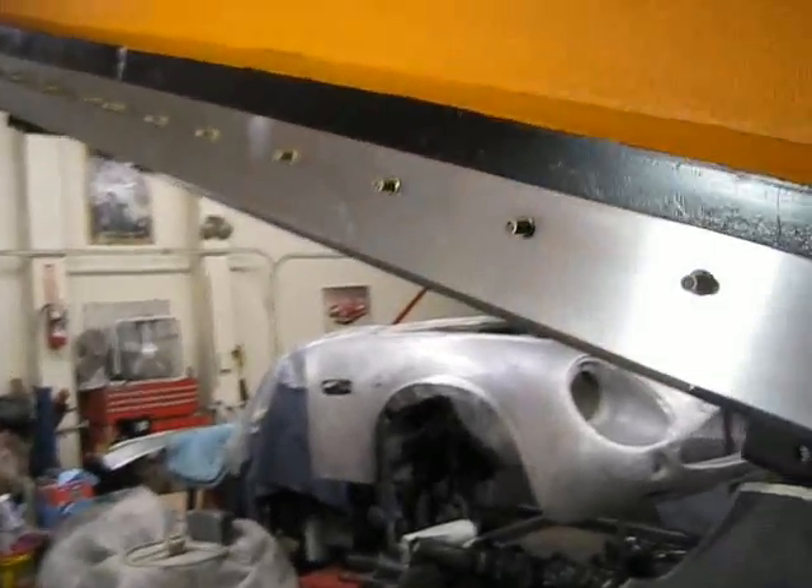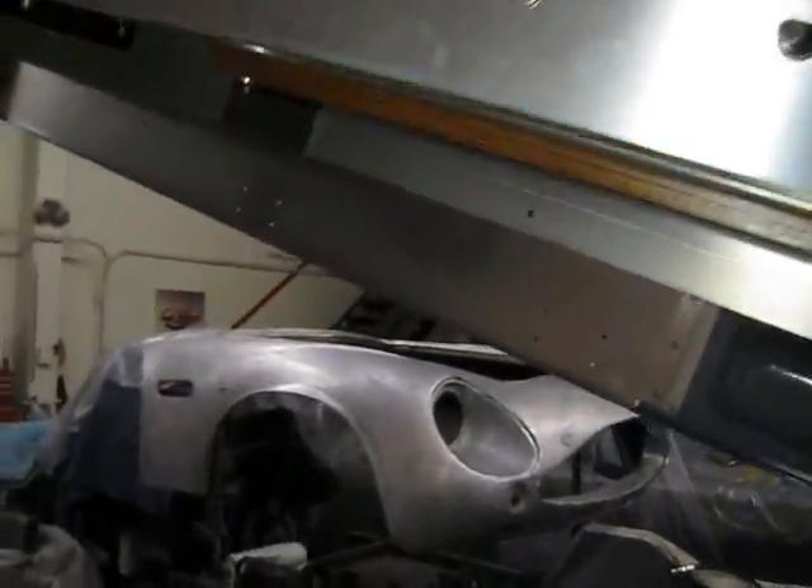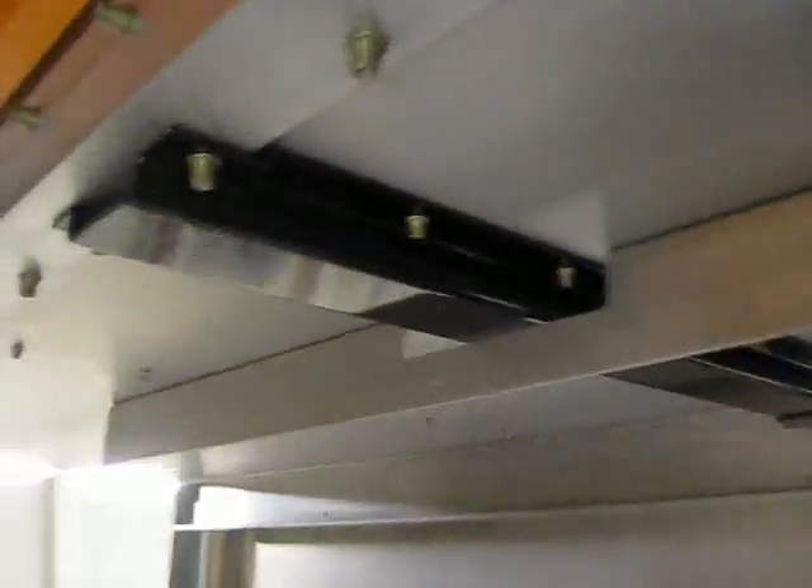One of the structural improvements is this rail here, which they added in later years and called the severe duty kit. But to be honest, every truck needed it. The cabs started getting longer and longer and they didn't really change the structure, so they got weak. This is a quarter-inch angle and it runs right from the very back, ties into the very back brace, all the way down. I extended the floor braces here so they tie into that and come all the way to the front — made this extra little bracket just to tie it right into the front for extra strength.